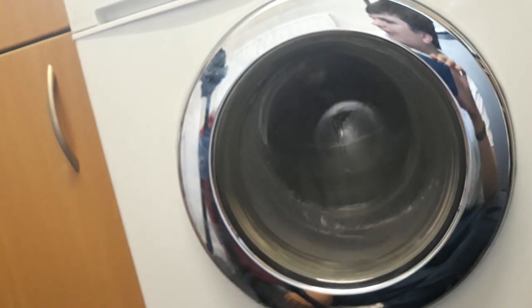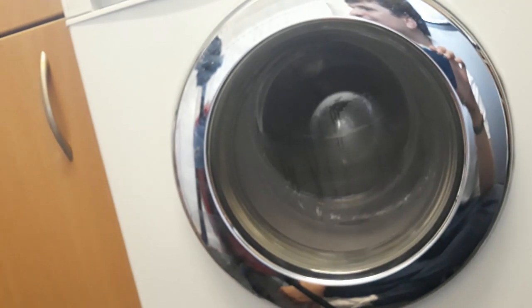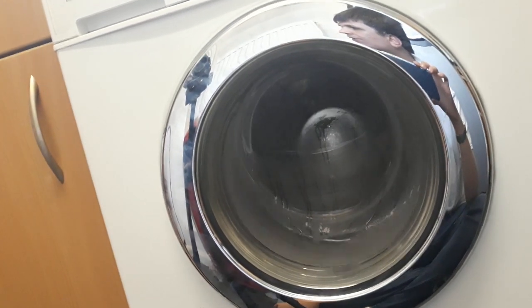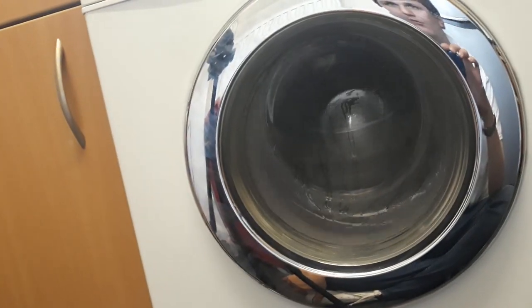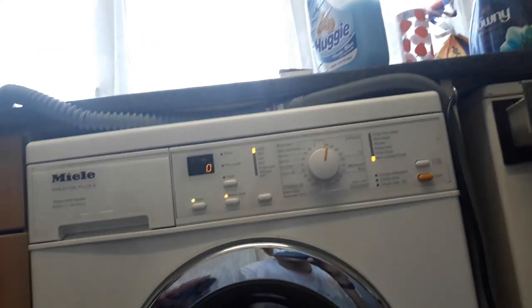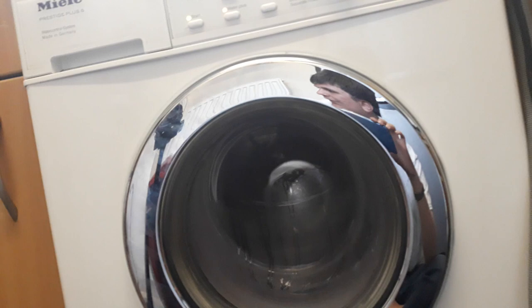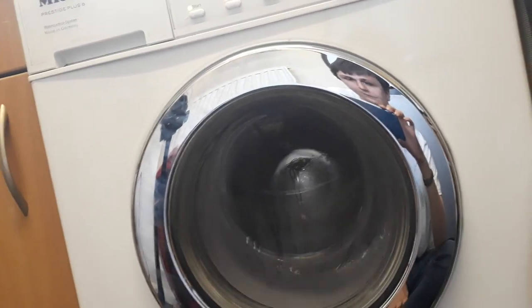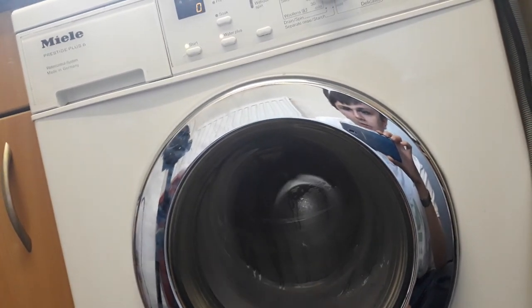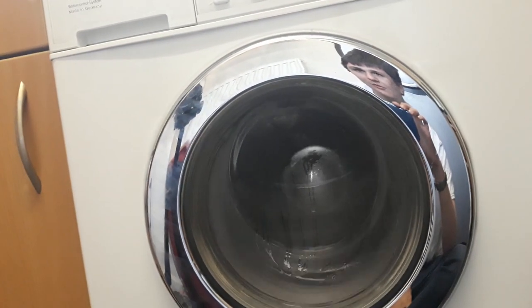It will turn the pump on. Do you remember when it was doing that weird thing where it kept the pump on? That's when the machine has a blockage in the pump — the sensor thinks there's still water in the pump. The shock absorber sound is normal on Mieles because their suspension is very rigid so it knocks. Every Miele I've heard does it — although I wouldn't be surprised if the shock absorbers are starting to wear slightly on this. It's not as bad as the one Josh filmed.